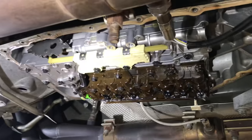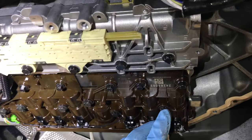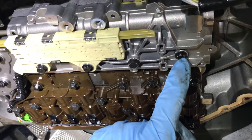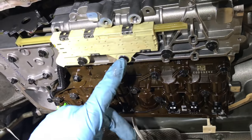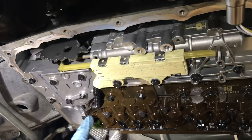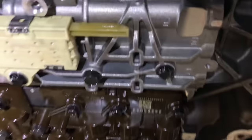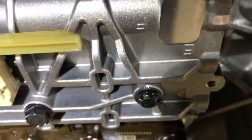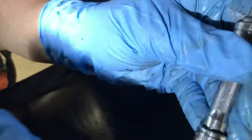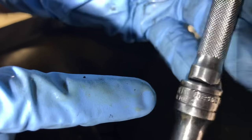So next thing to explain: there are six bolts holding the valve body in, and there is a special socket that's required. The six bolts are located here, here, here, here, here, and here. Some are 10s, some are 8s in valve bodies, but these are actually a little different. That socket is a Snap-on socket part number 10EPL — it's a Torx Plus Snap-on socket.